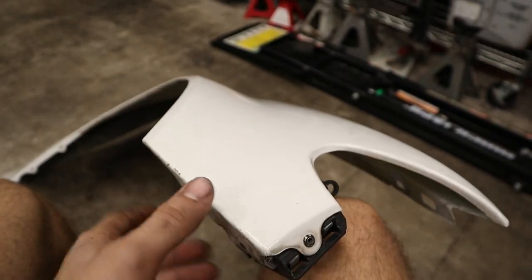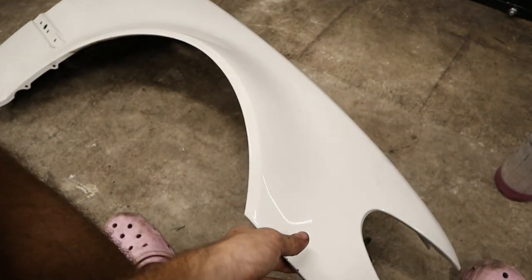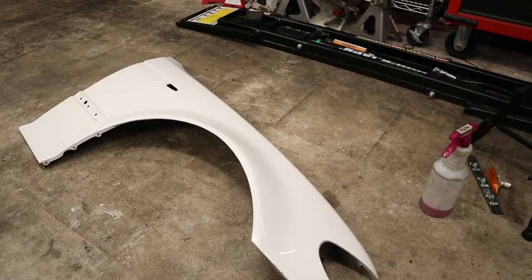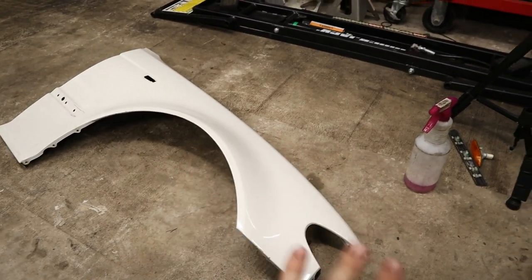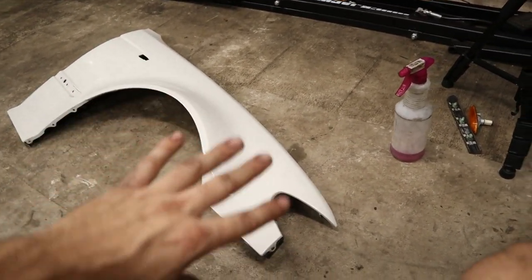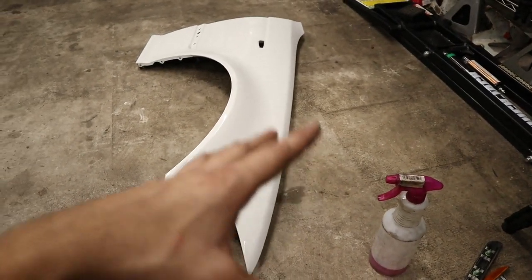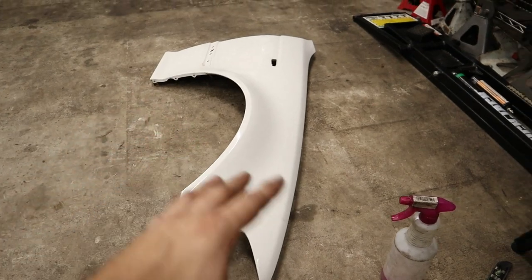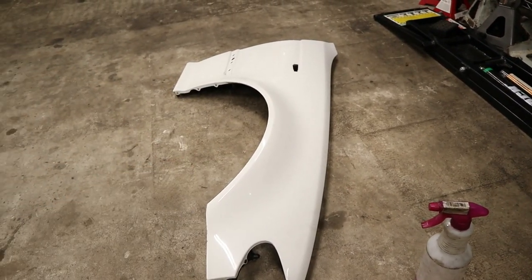So we're gonna do the best job that we can with the materials that we have and hope that it comes out real nice. But for now, we need to grab our prep pad. I think we might try maybe a sander, maybe some scuffing pads. We really just need to get all the gloss out of this surface and get it 100% clean. And then we can use something like mineral spirits or surface prep to make sure that there's no more oils on here. So let's go ahead and get sanding.